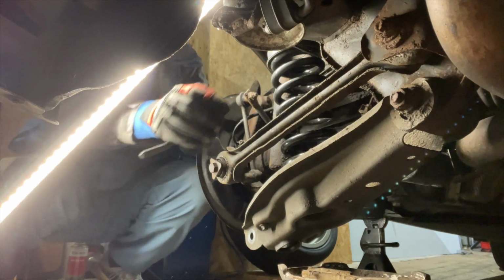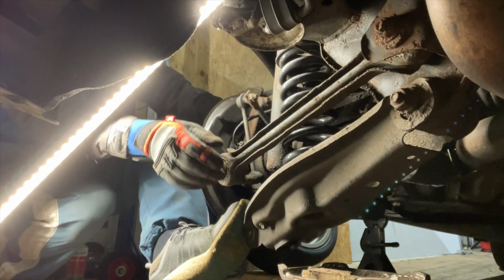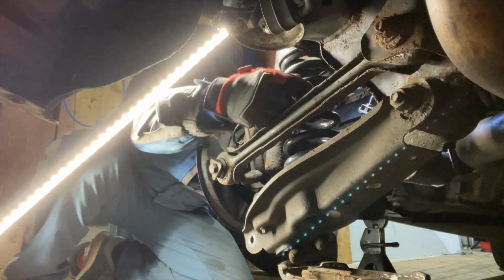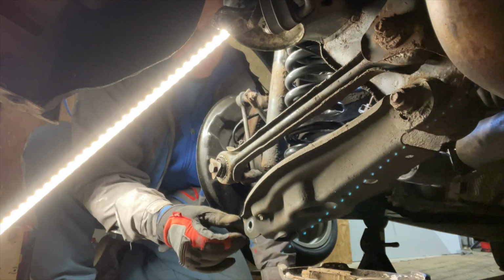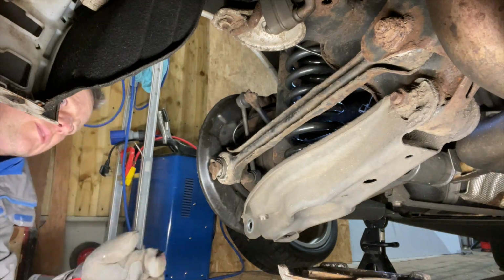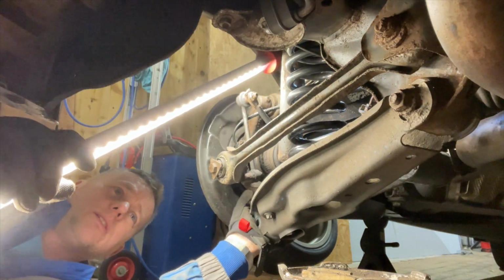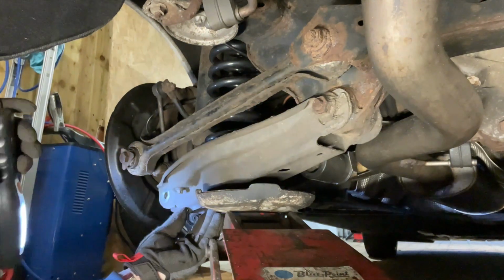It's just playing a little bit hard to get on that bottom there, just not quite sitting properly. Just needs to be tweaked round a tad so it drops into its little rubber cup. And that little rubber dobber on the top there should sit into its little cup at the top. So we're about there. Oh, yeah, come on. Little wiggle. Yeah, it's just there like that. Let's get that shocker all back through its hole. Again, just a little bit of a wiggle, left to right, get it located in that bottom bush. Make sure everything's all in place. That looks pretty good. And we've just got to get that across and get the jack back under it, then going up. So we just manipulate it, jack it up, in it goes, ready for the bolt to go through.